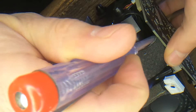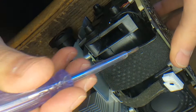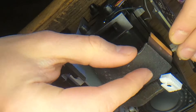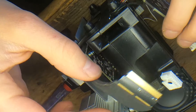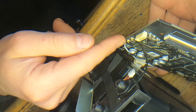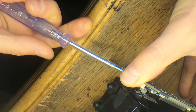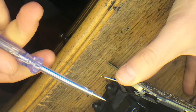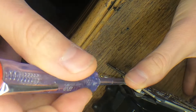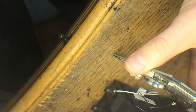Just lifting that cover off. This one goes pins down towards the board. This wire here comes to the connector on the left side, and the white one goes there. And then this one comes from the other side, underneath this ribbon, and connects somewhere here. That was definitely not forcing it. One, two. And the last one now. So at this point, all cables are removed.